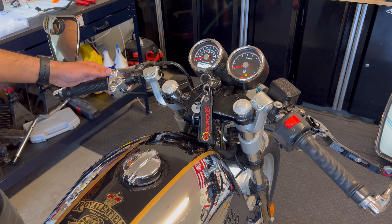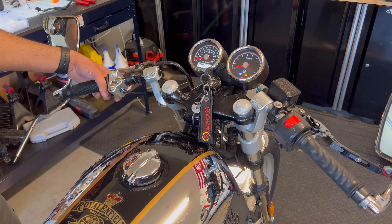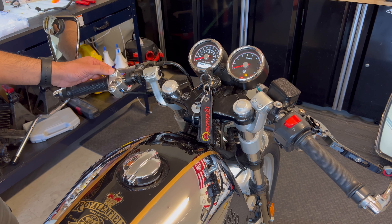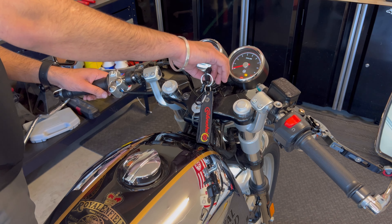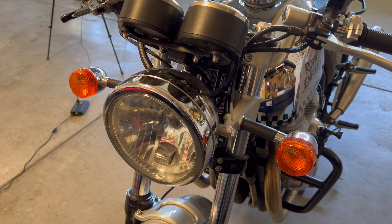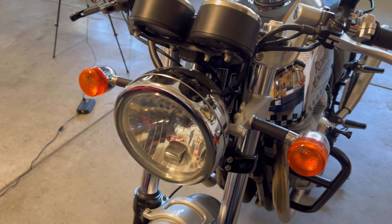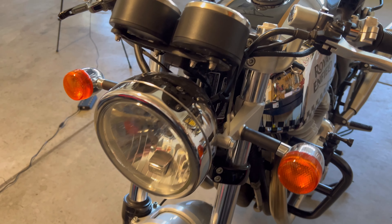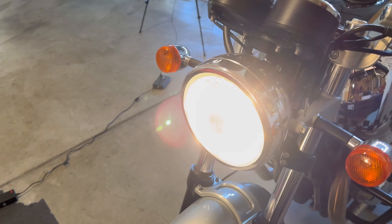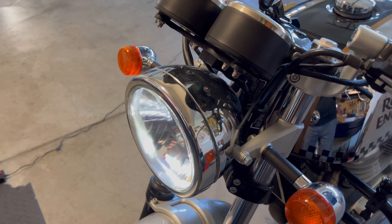That's your right signal. Left signal - it's actually reversed, so I need to fix that. That's high beam on and off, and horn. So everything's fine, it's just for these signals I'm going to switch those and retest. A really neat benefit I like about this switch is the back button right here - that can actually control your headlight. Before you turned on the bike the light would be on no matter what, there was no way to turn it off. But now you have the ability to turn the headlight on and off - how cool is that!